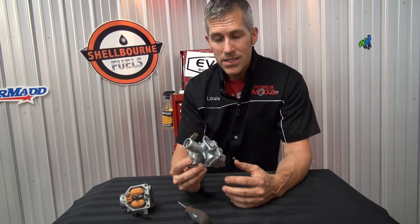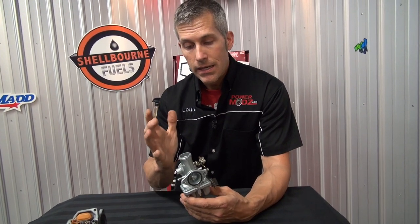When you buy something like this, it's more or less built to spec for probably many different models. They don't know what environment you're riding in or what altitude. And according to even Honda themselves, there are different jettings for different altitudes, so you're going to want to check that.